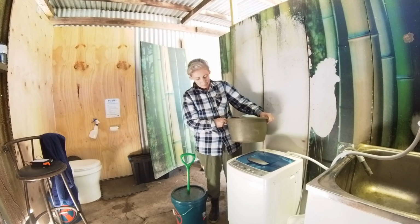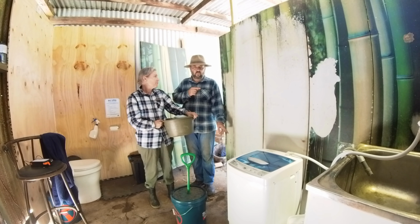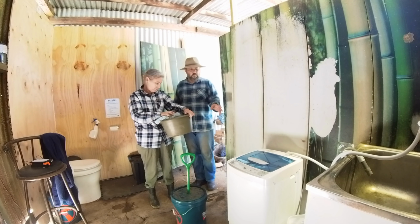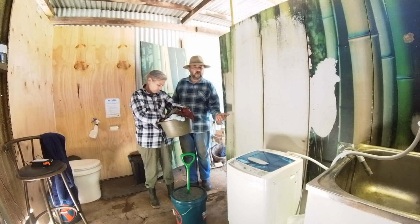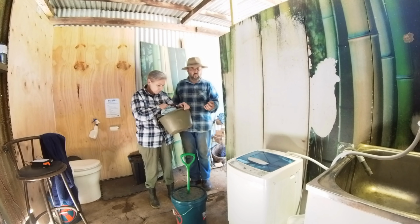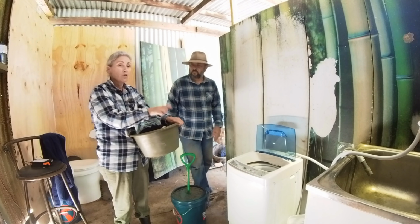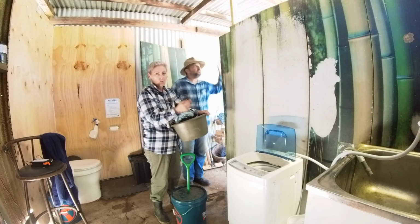And yeah, very happy. We haven't got our inverter for the battery hooked up yet, so we're running on a generator. That's a 2100 watt generator, and it was working a little bit during the spin cycle, but it never faltered or failed, never showed an overload signal. But that's the thing when you're using anything with a motor, induction, it does work, the inverters. Make sure it's the pure sine wave, not the modified sine wave, because you need that nice sine wave to get it going. Oh yeah, and the drum stays stationary. There's just the agitator, and then for the spin cycle the drum moves.